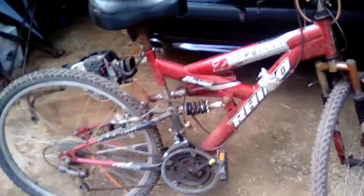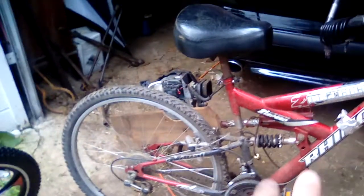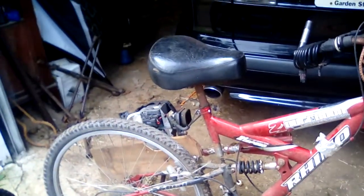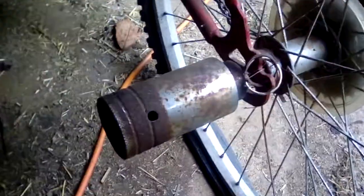This was actually the first one that I built. I built this one out of necessity. I've taken it apart and cannibalized it for parts. I used to have a gas tank that was just mounted to the seat neck there. How this works is you get a bicycle peg — you mount that onto the drive of your engine. That peg then rides the tire and you put tension on it with springs.